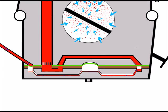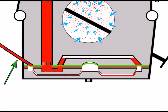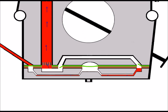So all of these fuel vanes now will just continue to be emptied as the fuel's used. And as you can see, there's plenty of fuel coming from the fuel tank. But regardless of this, you can see that the fuel vanes continue to empty, all because of the restriction there on the valve flap. And we've got to a point now where there's no continuation of fuel here, feeding the metering area and of course eventually the main jets.